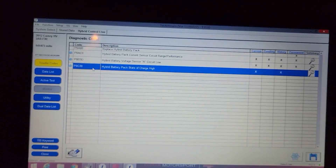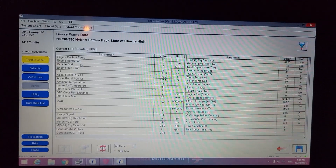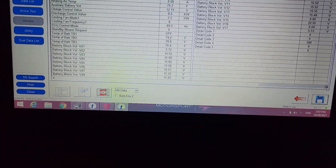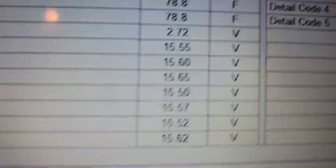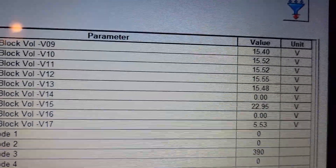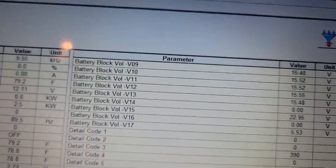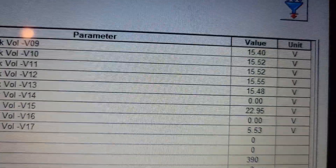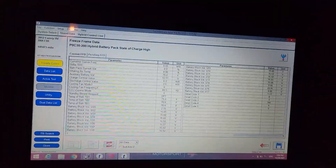You'll see something is wrong with the battery like I've never seen before — though people who fix hybrid batteries have probably seen this a lot. We have all the data here. Looking at the battery voltages, we have all the blocks reading around 15V — but look what happens between module 14 and module 17. We're getting zero, almost 23 volts, zero, and 5 volts. How is it possible that two modules are reading 22 volts? It should be reading only 15. We're about to find out.